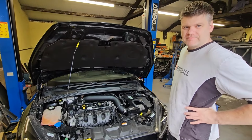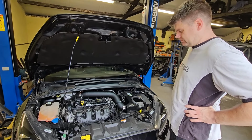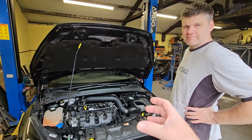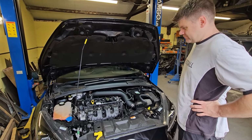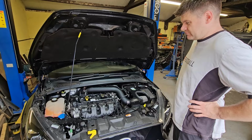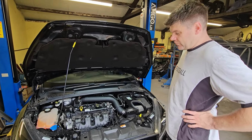We're going to get those over, and we'll get the local boys at Auto Engineering, Mark and Ben, to machine the middle of the block right out. We're going to put these bloody great Darton wet liners in there. We ain't going to fuck around. It's just going to be a balls deep, proper motor build, forged pistons, forged rods, because you don't want that to happen again, do you, Uncle Spike? No, once bitten and all that.